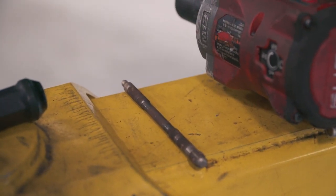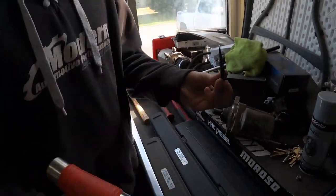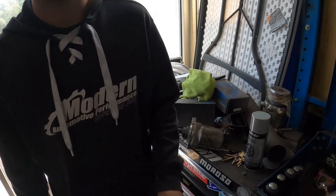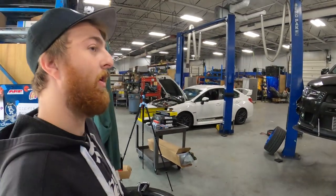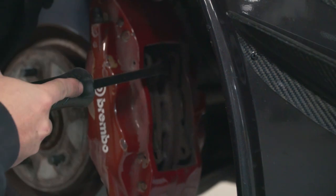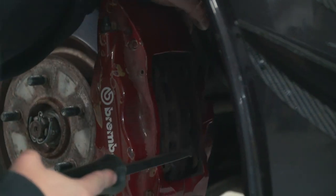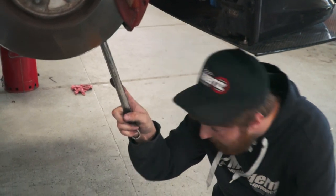So Tiny, what kind of tools are we going to need for this brake job? You're going to need a hammer, a punch, and I want to say it's a 17 to get the calipers off. These are fixed calipers because the caliper doesn't move - it's just the pistons pressed out. So all you have to do is take out the two caliper bolts and then it'll fly out of the way to change the rotors.